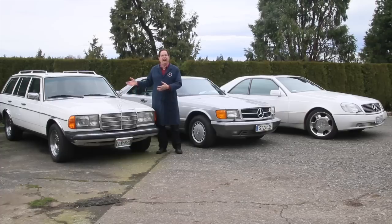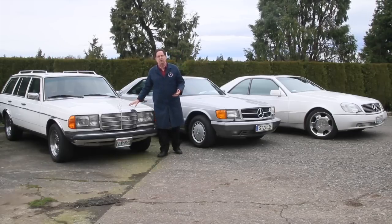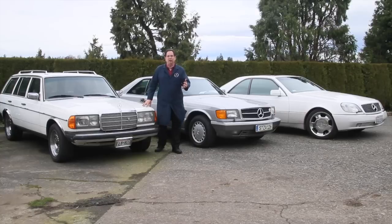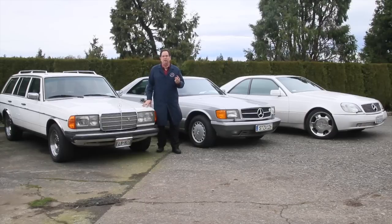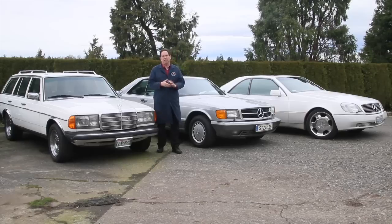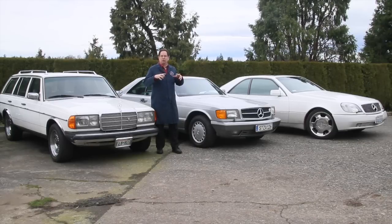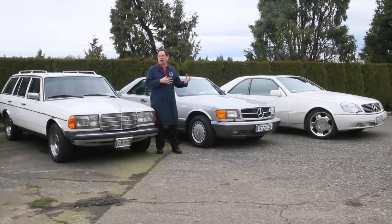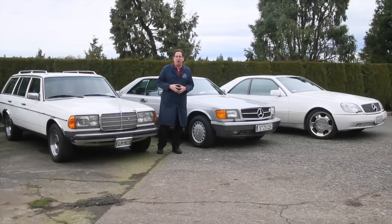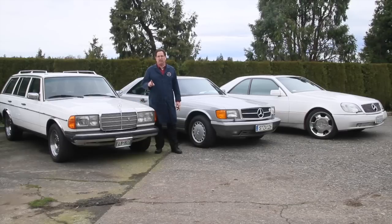I had to go back to my friend and ask how far he wants to go — new springs, new subframe mounts? I'm not sure how much we'll end up doing, but we will be filming through the series: the overhaul of the hydraulic pump, the overhaul and adjustment of the SLS valve, accumulator replacement and how to tell if your accumulator is bad, and hopefully changing the rear struts on one of these cars. The really in-depth step-by-step videos will be on my website, either coupled with a kit or tools to help you do this yourself. The number one goal is to show you that the SLS is not as complicated or as expensive to fix as people say — particularly if you maintain it properly.